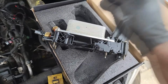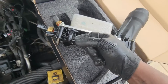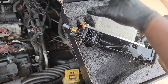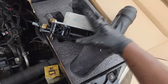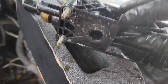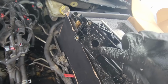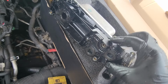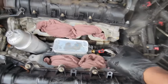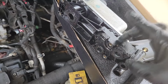No effort at all. Normally, I put my socket on there and jerk it to break it before I spin the wheel. Guys, no, I just set the socket on there, barely moved. I just turned it and it just started moving. You know what that means? I lost my torque. I lost the tightness of this being clamped down to the block simply because, in my opinion, it's all my opinion, these seals get so crushed, so compressed to where there's no resistance between the block and the cooler at that point. So, in essence, the plastic cooler is touching the freaking block. That block can get extremely hot. When that happens, that's when you can easily melt this.